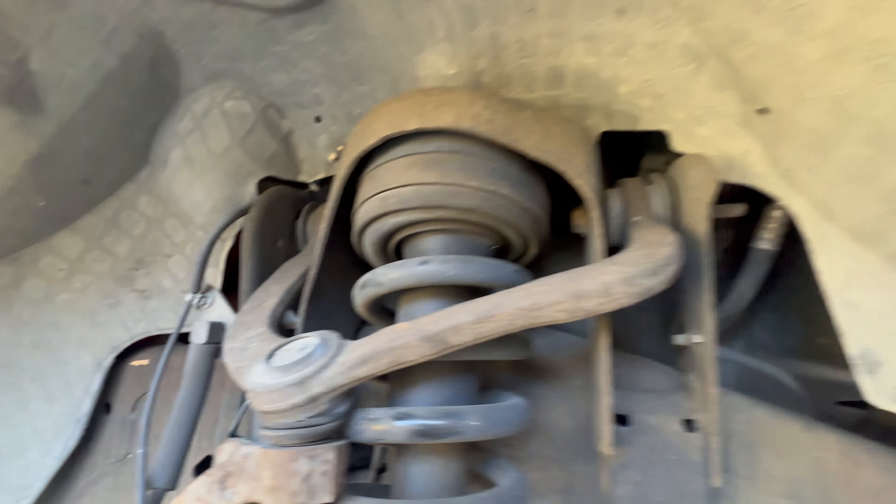Change of plans — I had to get a factory one. I got a Motorcraft one from O'Reilly's. I was putting the aftermarket one in and the grease fitting snapped right off, so I won't be able to put any grease in there. I'm taking those back and not going to link them. This is the right side — it says R on it. This is factory; the other side's already been replaced with the new one. The ball joint is good on this side and it's non-greasable for now, which is fine.